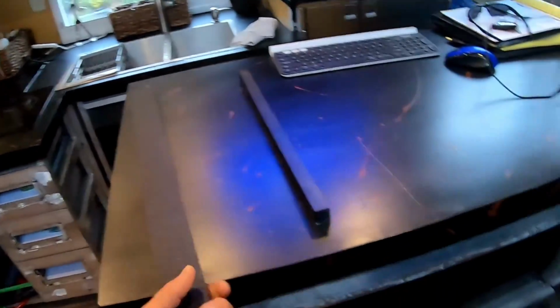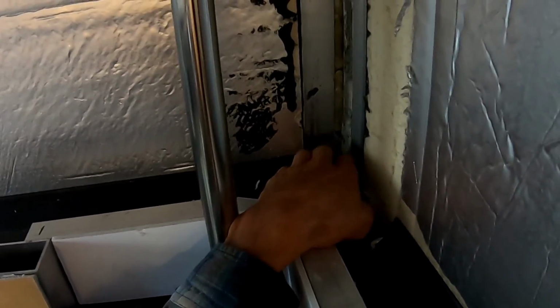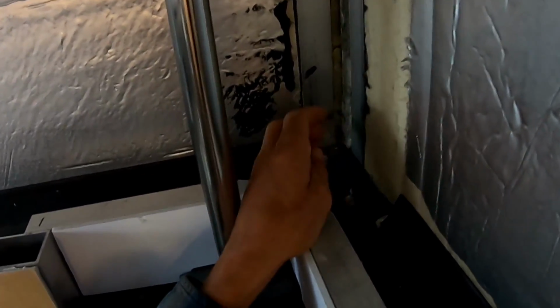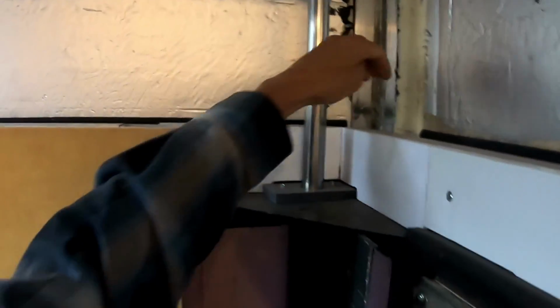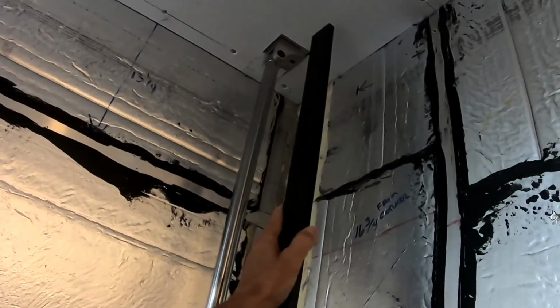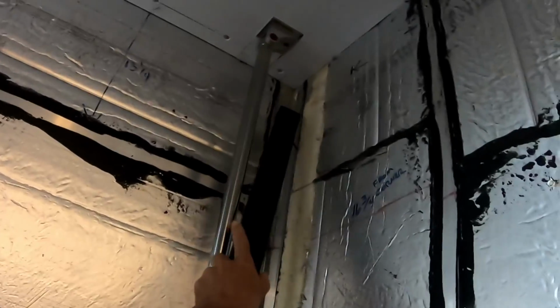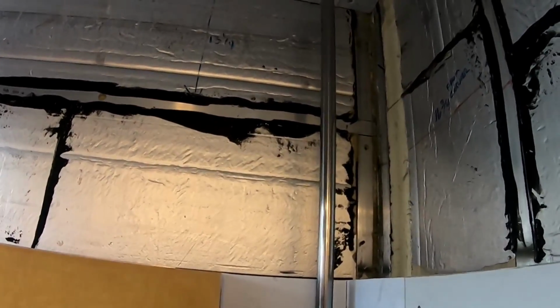And basically what I'm gonna do is replace these guys. In every corner I have these guys, same kind of thing. This is a Teflon wear guide, and this does a great job of keeping the gap at this point. But again, as this part of the roof goes all the way down, now it has the ability to do this. So all I'm gonna do is, once I finish the walls out on the inside, this is getting screwed into the corner there, and that will guide me down on the aluminum on the outside. So that will be my roof guide.